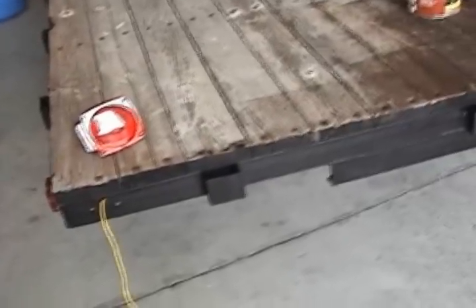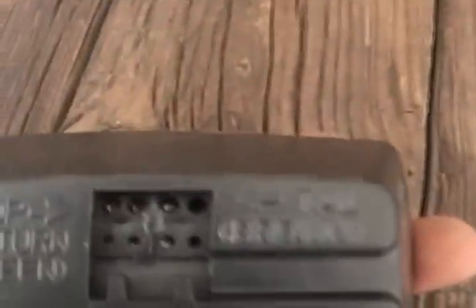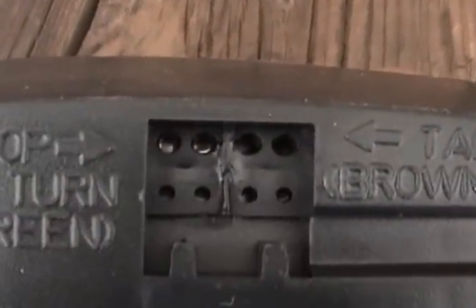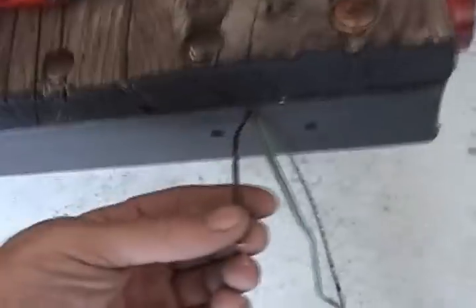Here at my shop, this is Mr. Energy 511 and we are going to wire some trailer lights for my little flatbed trailer. On the right side, the holes are pre-drilled and the wire colors are green and brown. The green is the right turn signal and the brown is the tail light. I've also got some running lights on the side and one up in the front — those will also run to the brown wire, I just ran an extra brown wire.